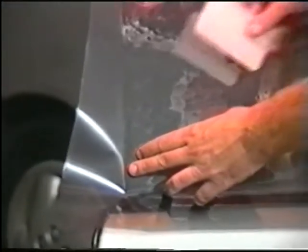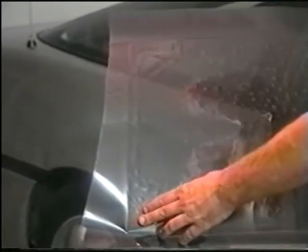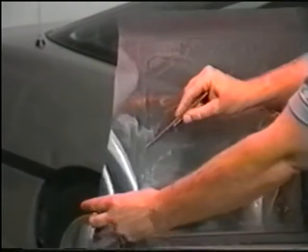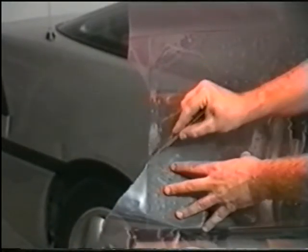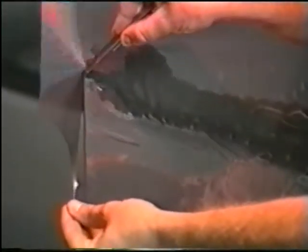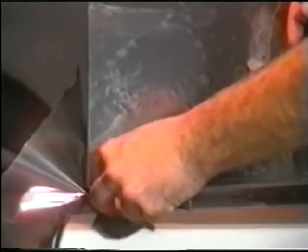The first cut that will be made is the left vertical edge. With your knife in the 2-3 click position, insert the blade into the film against the edge of the glass and cut out an indentation in the center of the glass. Again, relieving stress so that cutting is easier. Tear away the film and finish cutting from the bottom to the top. Now cut down toward the bottom and remove all scraps.